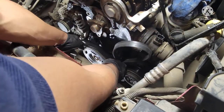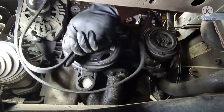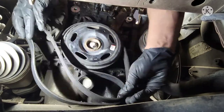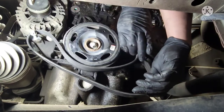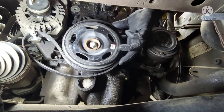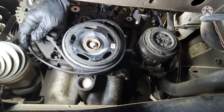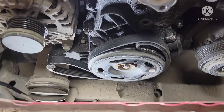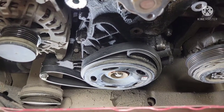Put it on the crank, goes over the crank, line up the belt — the two belts together here. It's gonna look like that. Make sure the engine is free to spin and there's nothing to interfere with the crank and the cam. All right guys, so it's gonna look like this from the top of the engine — that's how to set up the belt. Now let's go turn that bolt and see how it looks.